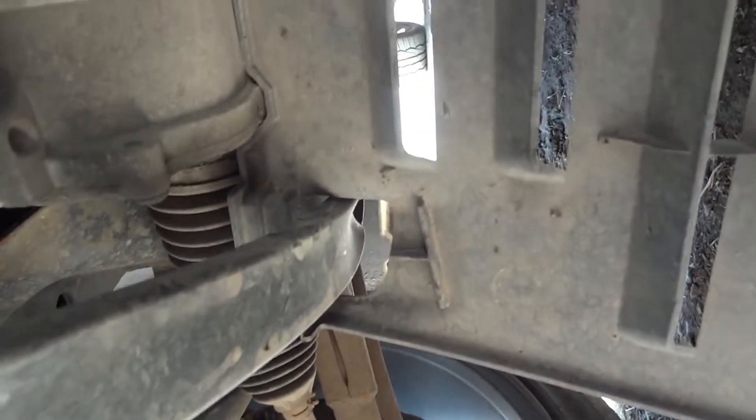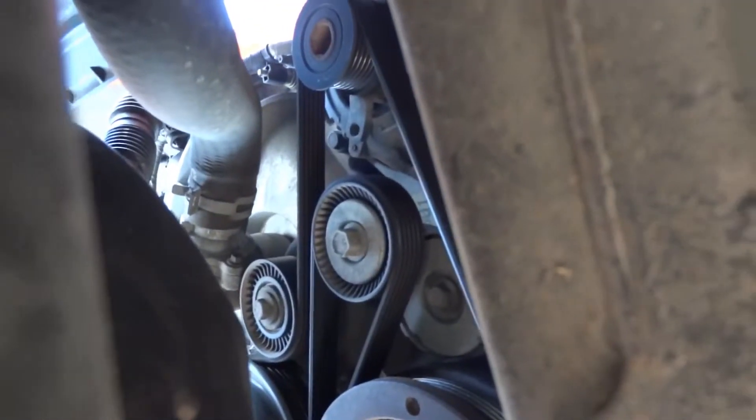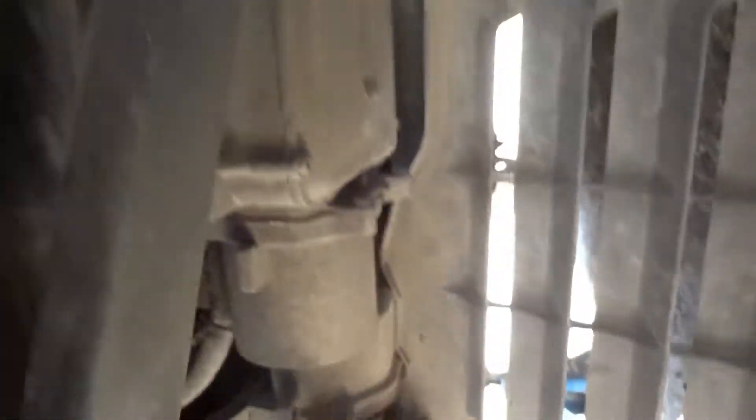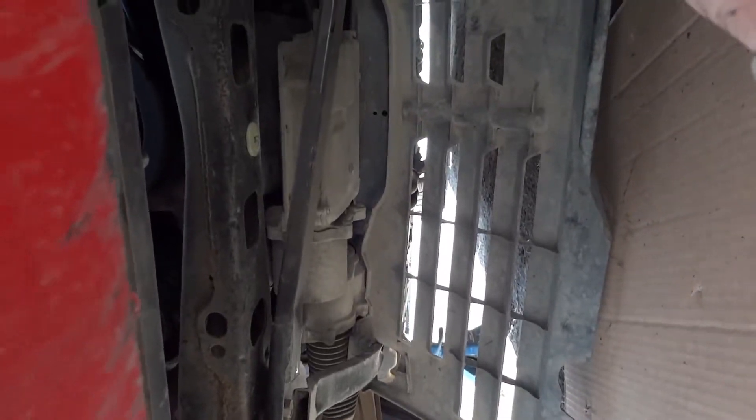There's another valence laying on the ground — it doesn't unhook unless you take that mount off the subframe at the front. That's how you actually do your oil change too. Right there, that's the part. This valence goes right here, so you need it under here. I'm lower than a normal vehicle so I'm just gonna tuck it a little bit. I've got cardboard under it. I should not push on the car because it's on jacks.